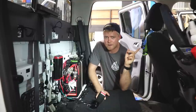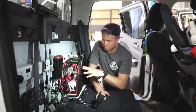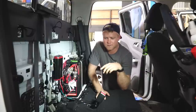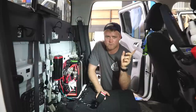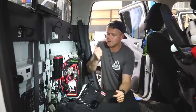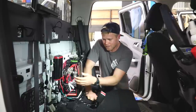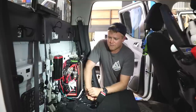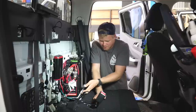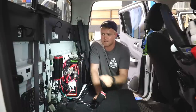Quick run through: we've got the 120 amp hour kick-ass AGM battery and the 25 amp DC-DC charger. When you're driving, power from your main battery goes through the charger to charge this one up. From here we're sending power through to the 1200 watt inverter at the passenger feet to convert 12 volt car power to 240 volt house power - I use that to charge all my camera gear, laptop, and phones. We're also running power through the back vent into the tub for the fridge via an Anderson plug, plus a couple of 12 volt and USB plugs in the back for charging things and running camp lights. Each line has a fuse so if there are any power surges, the fuse blows rather than an expensive part. The battery is mounted on foam, tied down with a strap - nice and secure.